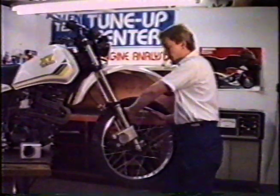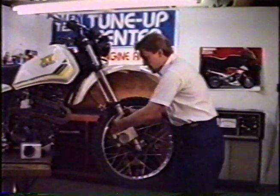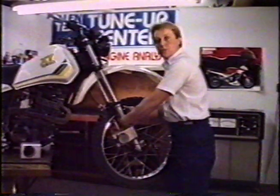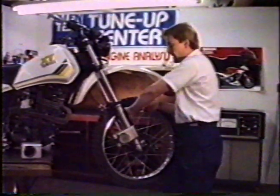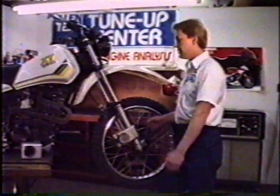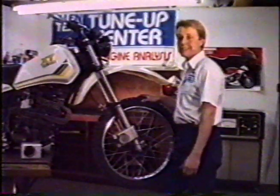To mount it, get a piece of steel, take 2 U-bolts, and clamp them to your fork leg. Again, don't over tighten it or your forks are going to stick. Then, perpendicular to that, you run 2 more U-bolts. That clamps the motor to the mount. And you adjust it to the front rim for proper tension.